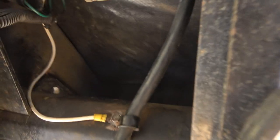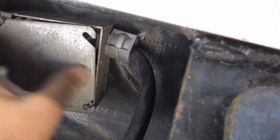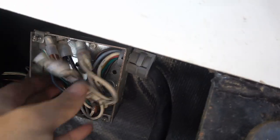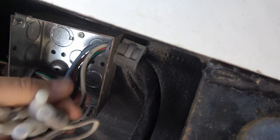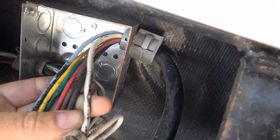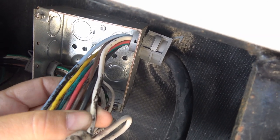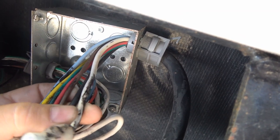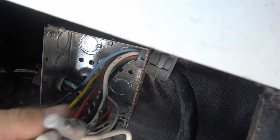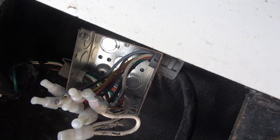Up in here is a junction box — there's a metal one right here. Just undo the screws and pull that off and you can see a bundle of wires in there. The actual inputs coming in look to be the same color coding — kind of a standard RV wiring color code — but it can vary from different trailers, so you can't be 100% sure. I'll measure it with my multimeter just to make sure it lines up before I start taking that all apart.